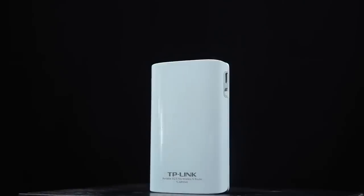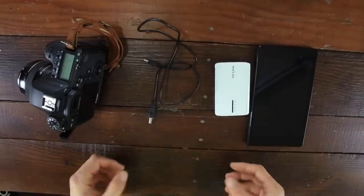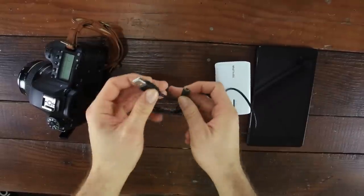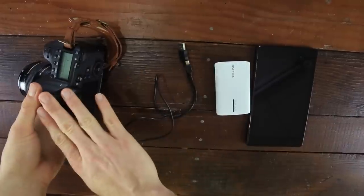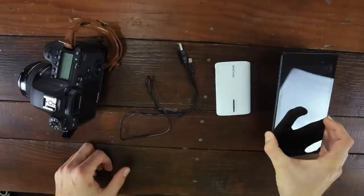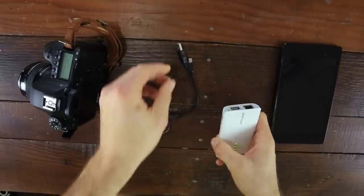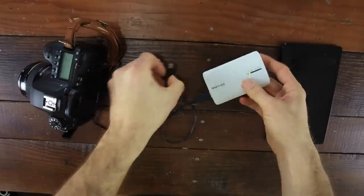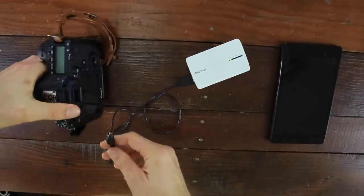So let's take a closer look at the TP-Link MR3040. To get things working, you're going to need the TP-Link TL-MR3040 wireless router. You're going to need a USB to USB mini cable — you probably got one of these with your camera. You're going to need a Canon DSLR. And of course, you're going to need an Android device equipped with Wi-Fi. To get started, you're going to want to power up your TP-Link device. Take this USB cable, plug it into the TP-Link like so. And once this other light over here starts flashing, your Wi-Fi should be up.